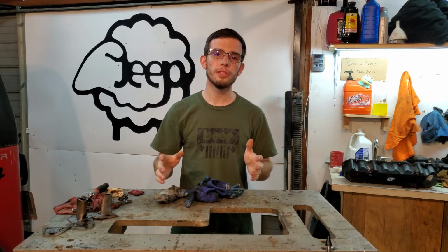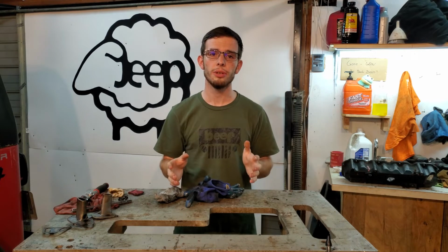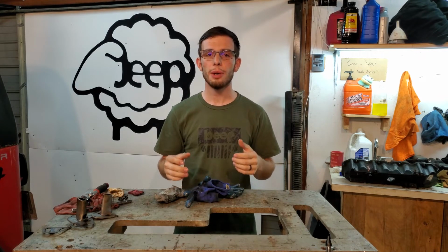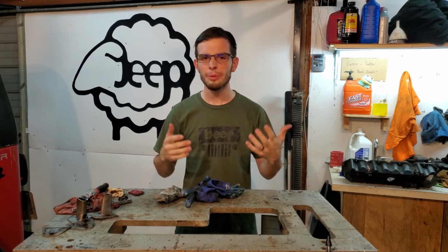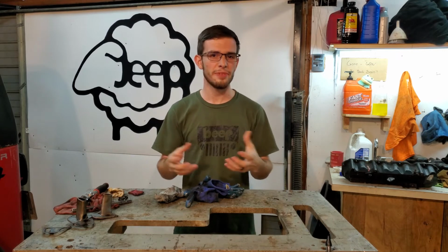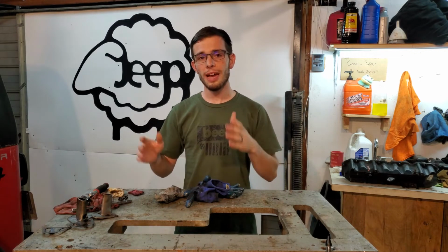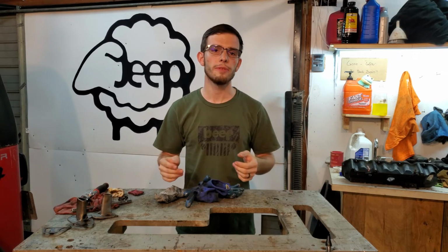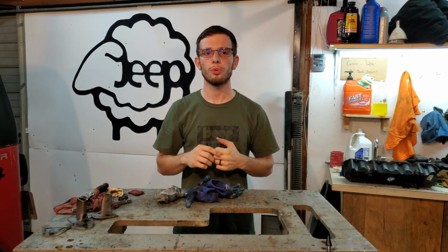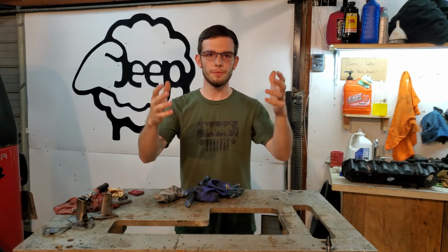Okay guys, I hope you find this video useful. Something like this where you're taking off the valve cover and cleaning it, it seems like a lot because it's tearing apart the engine. It's really not a big deal, and it is something you should be doing. I'm not entirely sure how often you should be doing this, but if I was to take a guess, I would say about 20 to 30,000 miles, or maybe every 2 years, you should take the valve cover off and make sure it's breathing properly. Because when it gets plugged, it just gets kind of exponentially worse. Also, the vacuum lines, you should be checking those at least once a year, if not twice a year. And that metered orifice, that little fitting, you should be checking that also once or twice a year as well. And your engine should be running very clean and happy if you do this.